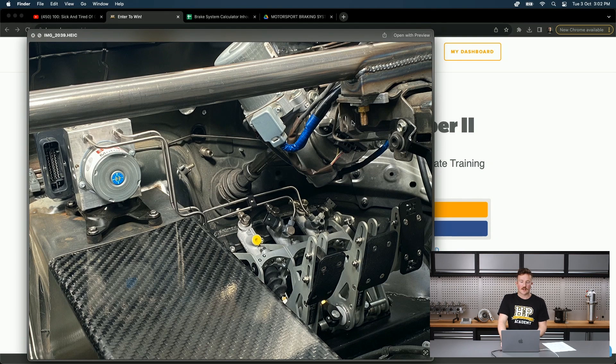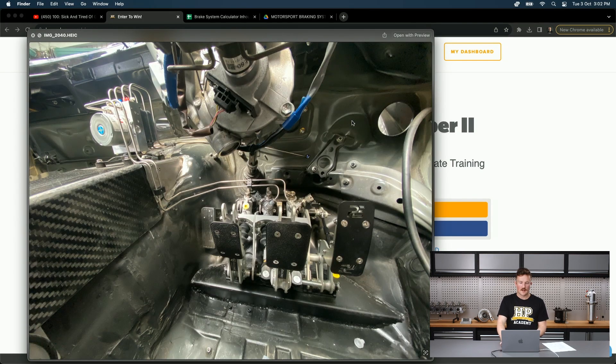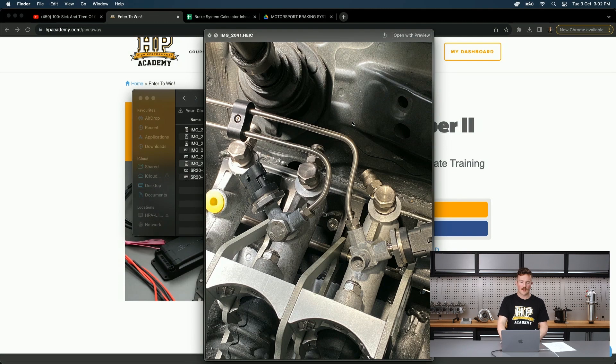We've also made the move from the factory pedal box with the brake booster to a motorsport-style pedal box with a brake bias bar. This is a Perusik Engineering unit out of Australia — a really nice piece of kit. Brandon's 3D printed these fittings here as a test fit before ordering them from Europe. He modelled them in CAD to make sure they fit — they're fittings for the master cylinders for the brake lines going to the Bosch ABS unit, and they also have brake pressure sensors. The rear one will also serve as a brake light switch.